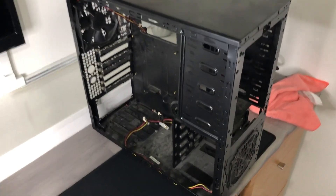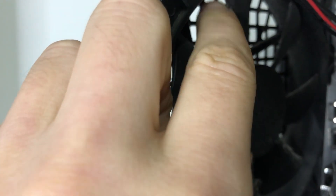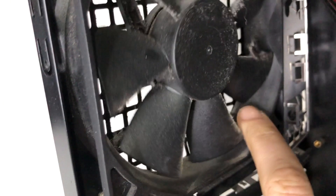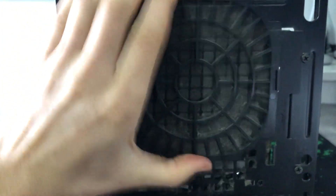This is the old PC case. Look at this fan - all that dust on there. This is what happens after a long time: all that build-up of dust slows down the airflow. If you've only got a couple of fans cooling your PC and they're as clogged as that, they'll really reduce airflow and things can get hot and you lose performance. On the back here there's a removable filter - you can actually slide these out, so if you've got a PC this might be what you have.